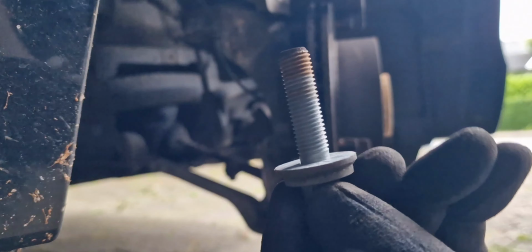So after we have done everything here, we have also to wipe the disc with a brake cleaner, so that we will not have contact with grease and stuff. Make sure you put the Loctite before putting back the 14 millimeter nuts behind. So the 13 millimeter nut here is tight. You make sure that everything is lining up when you rotate the brake disc. Make sure that it's not wobbling or it doesn't change any pattern here, like it's uniform, that everything is okay.